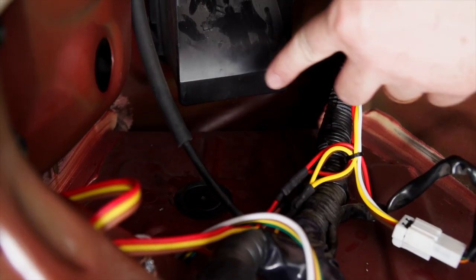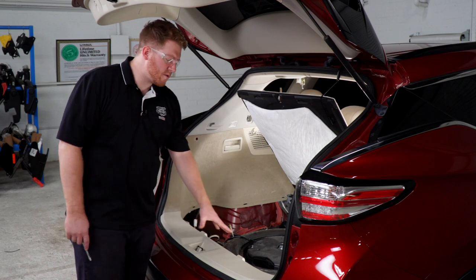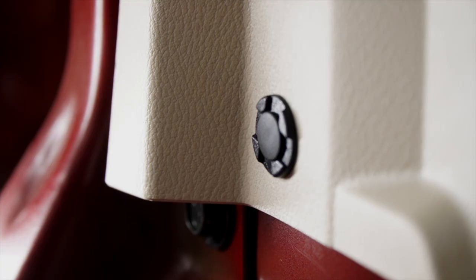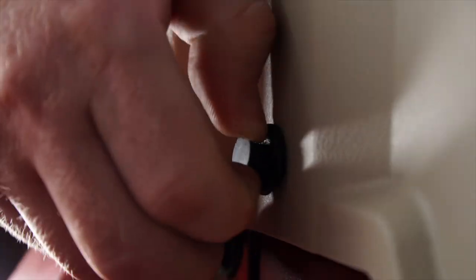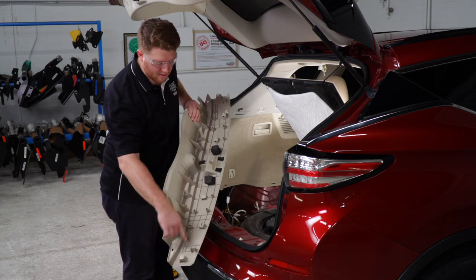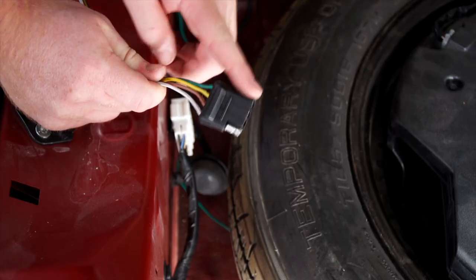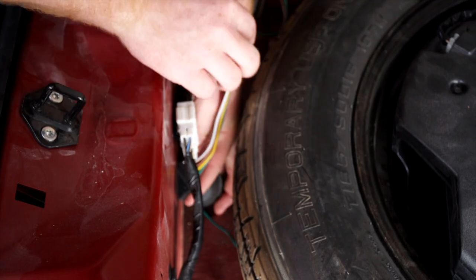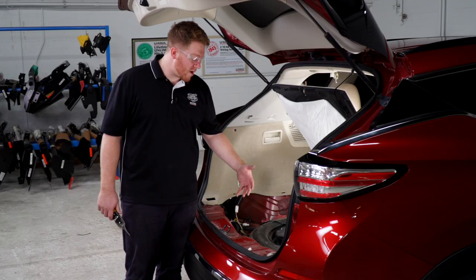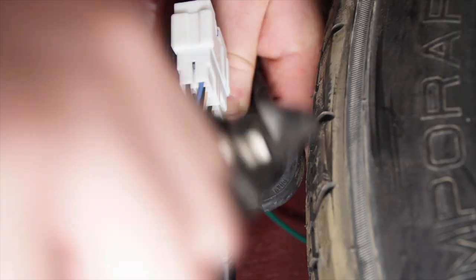On the driver's side there's a grommet and a vent that are too small for our harness to fit through without cutting it. To avoid cutting it, we're going to access a bigger grommet underneath our threshold panel. To remove the rear threshold panel, we'll remove three push pins using a flat head screwdriver, then remove a tab and pull up on the rear threshold — it's held in by clips. That gives us access to this new grommet. We'll remove it, push our four-flat harness down through it, reattach the grommet after cutting a slit in it, place the wire inside the slit, and put the grommet back into place.